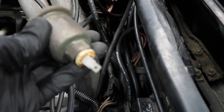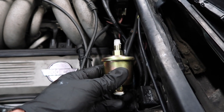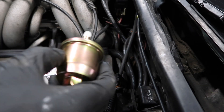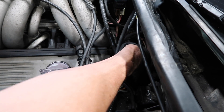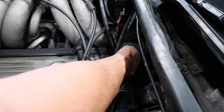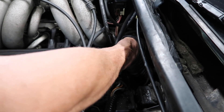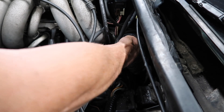And here's the old one. I'm ready to go back with the new sensor — either Teflon tape or thread sealant on there, then run it back in. This sensor is responsible for sending a signal to the fuel pump relay when it sees oil pressure. If it doesn't see anything above four psi, it won't send the signal. So besides leaking, they can also cause a starting issue.